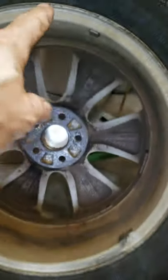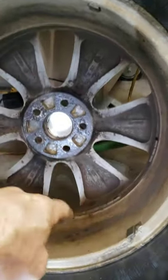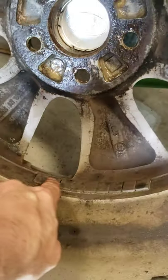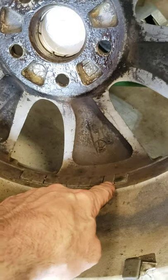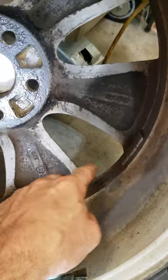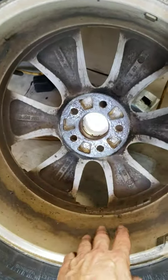You should only see one weight, I should say, on one section — not across, never. On the inside here they've got the sticky weights, that's fine, that's a pretty good amount of weight, and this is by ounce. But then there's a gap, and then there's more weight up here, so the balance is completely incorrect for this tire wheel setup.